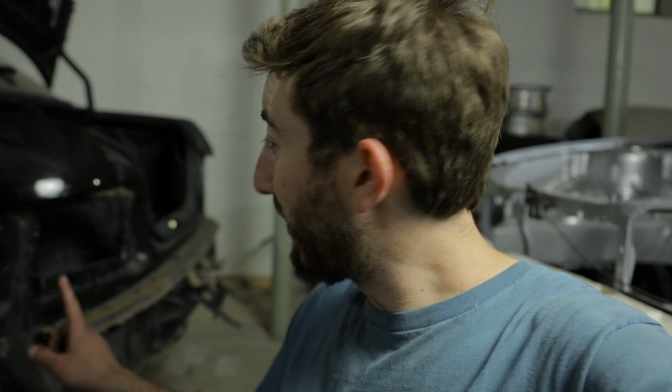I'm going to try and go in depth with this one and show everything I'm doing on this. But in general, edges like this are very critical. This is a key point where paint could peel, and if you leave stuff in, you really can't get in here and do a good job of sanding this. And when you're taped right up against the edge, it just makes it hard, and that's where you run into problems. So this is the right way to do it. Take everything apart. It takes a little bit more time, but it's going to save you time in the long run, and it's going to make it look way better because you don't want to go to all this trouble and not have a good outcome.